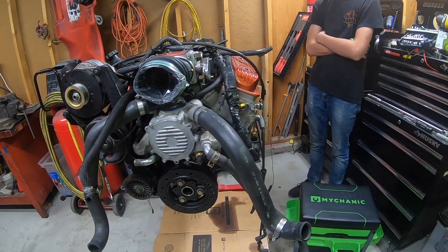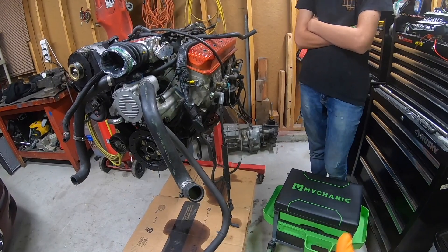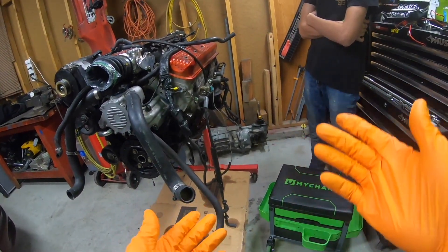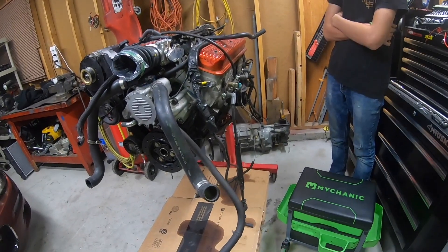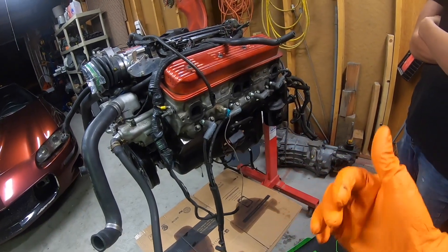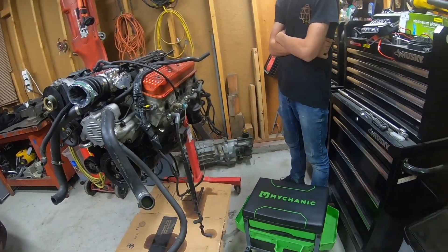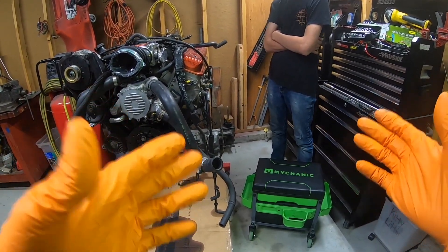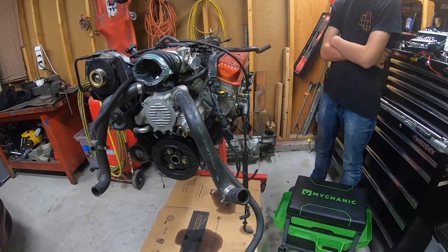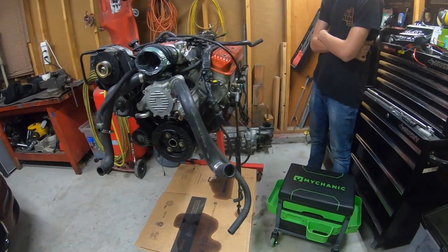This time around I'm making sure the heads are done right. Anyone who's worked on LT1s knows about Lloyd Elliott in Texas — I highly recommend him for heads and cam work. I'm going with the LE2 package: new valves, a bigger cam, my goal is to rev close to 7,000 RPM — around 6,800 to be safe on the bottom end. That means porting the heads, a bigger cam, bigger valves, and possibly bumping compression with a thinner head gasket. I'm also sending in my intake manifold — depending on the cam, you can make an extra 20 to 30 horsepower just by porting the intake manifold, so it's totally worth it.